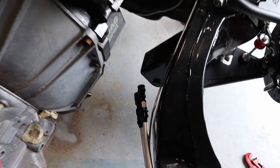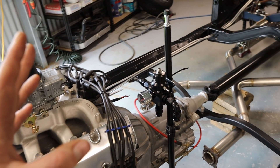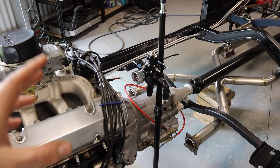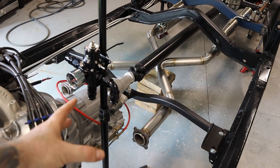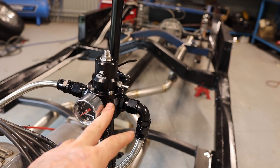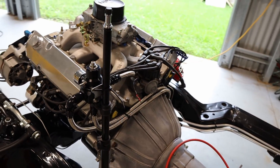With the regulator, I've just used a light stand to dummy fit it - I'm not sure exactly where it's going to mount, but I'll give it a little bit of slack so I can move it around. I can cut the hoses back a little bit later on, but for now I'll just dummy fit that. That is everything all plumbed up. The intake goes into the regulator and that goes to the carby, and then the bypass goes back to tank. Everything looks nice and neat, just following the back of the engine and into the tubing.